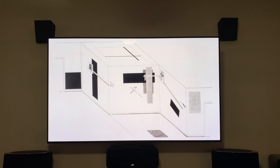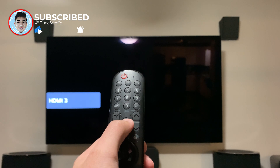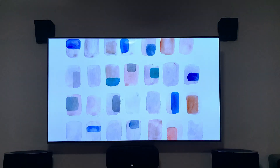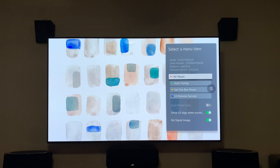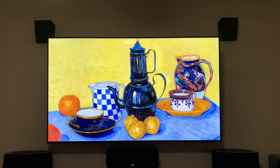Tip one: when you first turn these TVs on and off, you'll see the LG logo pop on and then the TV goes off. To turn that off, turn the TV back on, and once it boots up, press the mute button at least five times. It will pull up a menu — go to 'Show Logo,' select 'LG logo off when turning off the TV,' turn that off, press back, and now when you turn off the TV, it no longer does that.